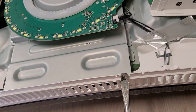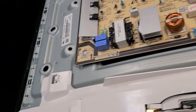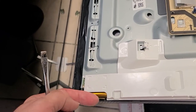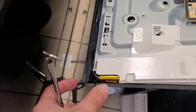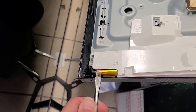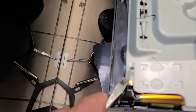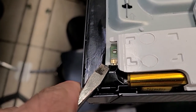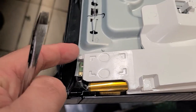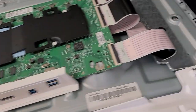Otherwise, the most that you can do is maybe break some plastic, and that is not so fatal. The important thing is to look at what's inside and where you can and cannot insert the tool. Simply put, the edges — this is about 2 inches until that tooth here. Underneath here you don't put anything in. Here on the edge you can, slightly — this is the end of the board here. It's really hard to go very deep in. But pretty much this whole corner and the other same corner, you don't want to put anything in.